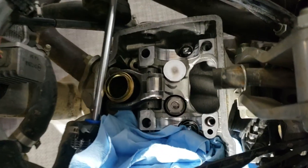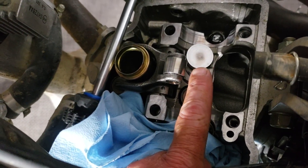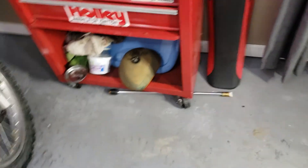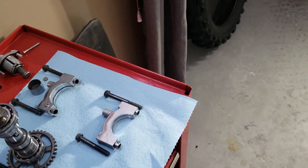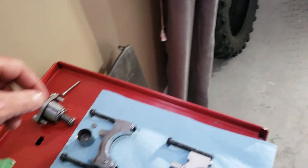Going from 1.77 to 1.75 which should be fine - we'll check all the valve clearances. I'm going to close the shim kit before I spill it. Here's what the top of the cam bucket looks like with the bucket off versus with the bucket on. I'm going to pull the next cam bucket, keeping everything in crazy order because I don't want to be mixing up parts. There's the old shim.